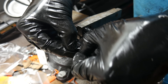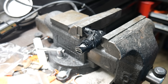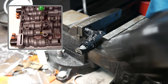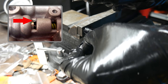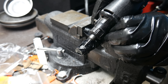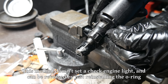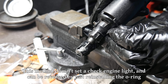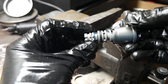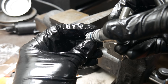With only 80,000 miles on it, it's unlikely the regulator valve bore is significantly worn, so I don't really want to go through installing aftermarket parts, most of which require reaming the valve body for an oversized valve. An old school fix is to stake the regulator valve in place, but doing this can overpressurize the torque converter. So all we're going to do is use a Dremel to cut a slot past the o-ring on the solenoid to delete the PWM torque converter clutch function. This makes the lockup perform more like an older 4L60E or a 700R4 where the torque converter clutch gets more pressure and is either locked or it isn't. But that's enough about that — now we'll get back to putting the valve body back together.